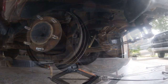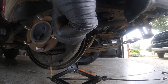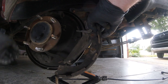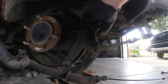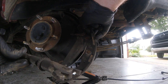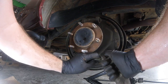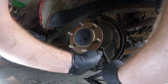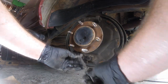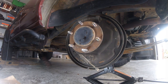The next shoe is the exact same way — get your needle nose pliers on it, figure out the best way to compress the spring a little bit and everything falls apart nice and slow. This is the auto-adjusting strut rod. You can see how dirty it is — make sure that you clean it up with brake cleaner, PB Blaster, whatever, so that the threads are nice and clean and it will actually auto adjust and not just get bound up. The last piece is the cable — pull the spring back so you can get some play on the cable and just pull it out. And your drum brakes are all torn apart.